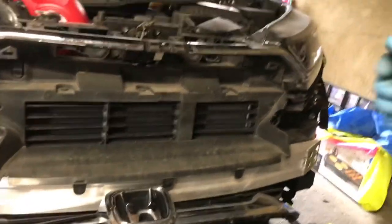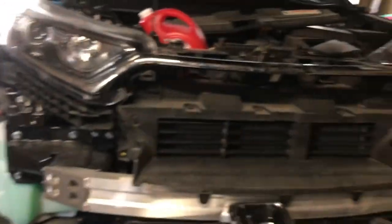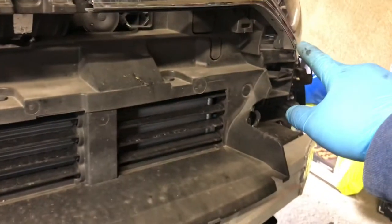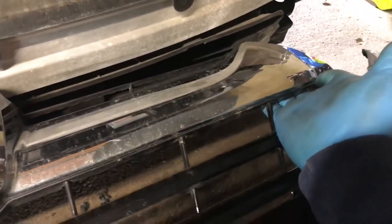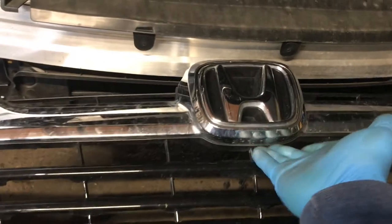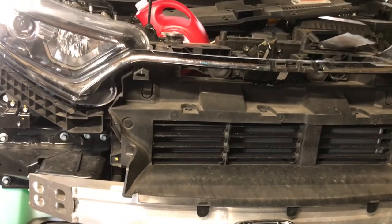Right after you take off the clips, all you have to do is pry the bumper from each side first — pry it, pry it — and then work to the middle. When you get to the middle right here, what I did was put my hand right under here and I yanked it — not aggressively, just enough — on this side and also the middle, and it should just come up. Sorry I'm breathing heavily, but now let's get the fog light installed.